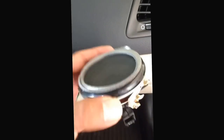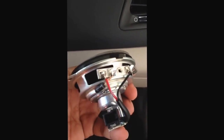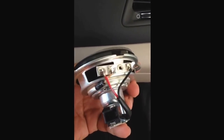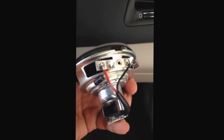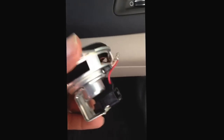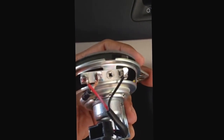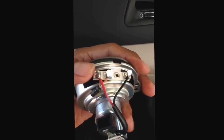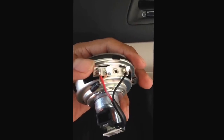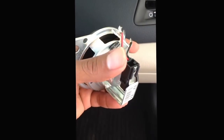This is a factory speaker. What I did on the other side was — you notice how there's plenty of speaker wire still to use to run to the new speaker. What you want to do is use that SAM adapter. So what I did on the other speaker was I just snipped the speaker wire here and here, and then wired it directly to the new speakers and then just plugged in the adapter.